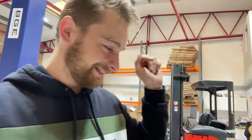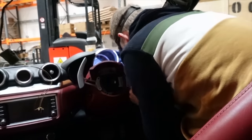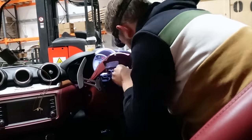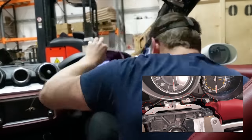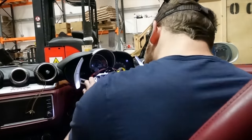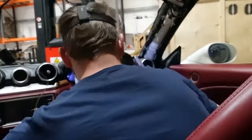The parcel has just arrived, so we're on the home straight now. Let's get this dash finished, get the steering wheel put together properly and the airbag in. Interestingly I just realized there's VAT on this, so once I've claimed it back it's actually only going to be £300 — pretty happy with that. I started off by attaching the top part of the leather trim that sits beneath the cluster — these are the four holes where they screw into. After that I'm fitting the new clock spring, held on with three small screws, plus an electrical connector.